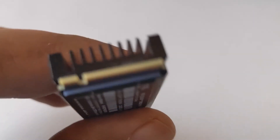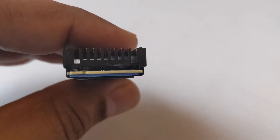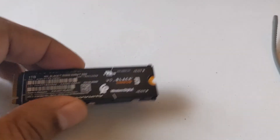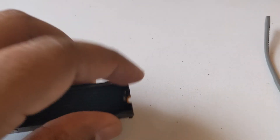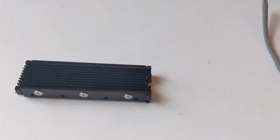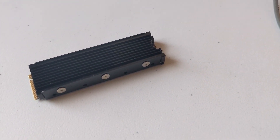This thing fits so tight. There is no spacing at the edge — that's because there are no chips or chiplets sticking up, so it sits right on top flush. I squeezed it down and again I just put the sticker on the outside so I can remember which drive this was. Based on how I saw it was seated, I can already tell it's probably going to give me a 10 or 15 Celsius drop, because the heat sink was sitting flush against all of the chiplets and spread out the thermal paste perfectly, just like what you'd expect on a CPU.